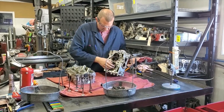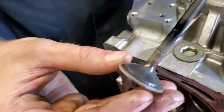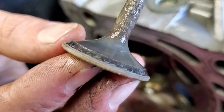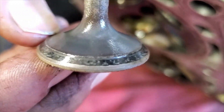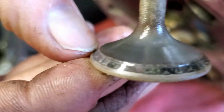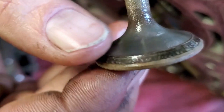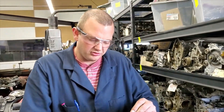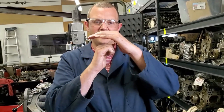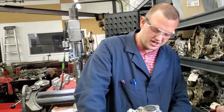This is the cylinder we were having those vacuum issues on. I'm going to look over the valve seat and see if there are any big signs of issues. There's kind of an edge here on both sides of that seat where it's got a carbon build-up — that could be part of the problem. It does look like there's some pitting and the whole thing's a little blackened. We're probably just worn out beyond the other ones to the point where the seat-to-valve contact is getting a rounded edge instead of a nice solid flat-to-flat surface, and that's going to cause some bad vacuum.